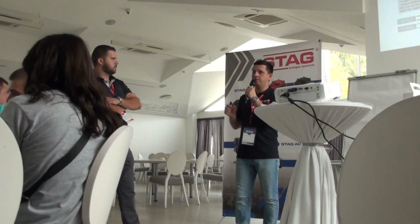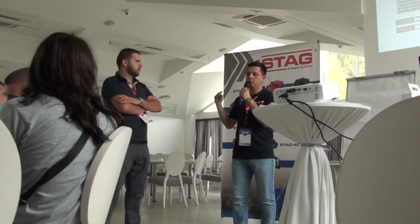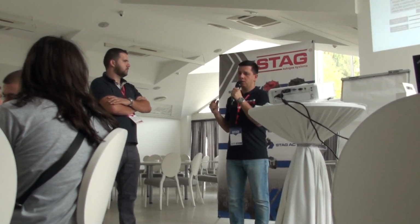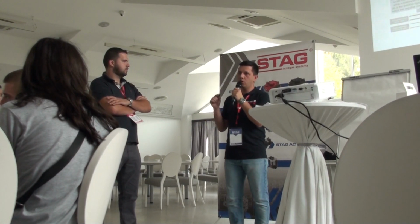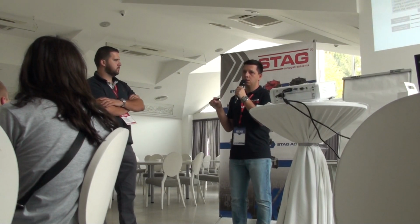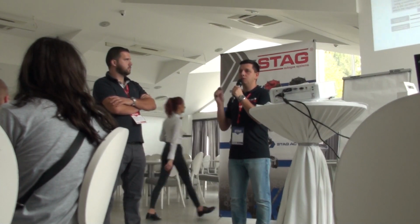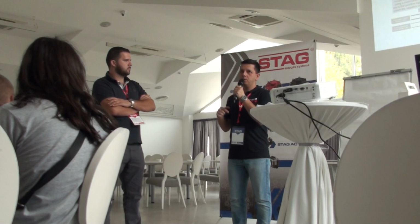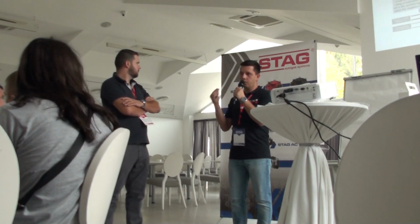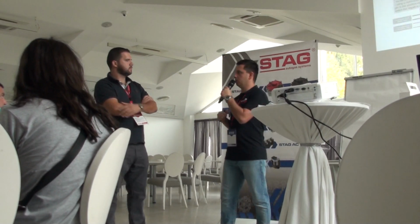On one cable you will have some value of voltage, for example 2, 3, 4, 5 volts, depending on the position of the float. On the other cable, you can have 0, that will be the ground, or you can also have some voltage on that cable, but with minus. So the cable with voltage and without minus is the signal cable. The other cable is the ground cable. On the ground cable you can have zero, it's ground, or voltage with minus in front. Okay, this is the ground cable.